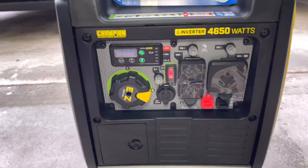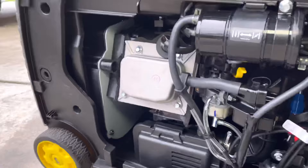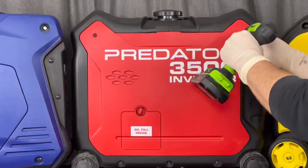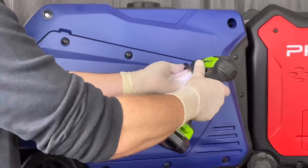What happens is that the low speed circuit on your carburetor gets plugged up from debris that's in your fuel system. But sometimes the generator will actually run just fine when you turn off the choke or eco mode and run it at higher RPMs and it sounds just fine. We'll go ahead and remove all three side panels real quick and get started.